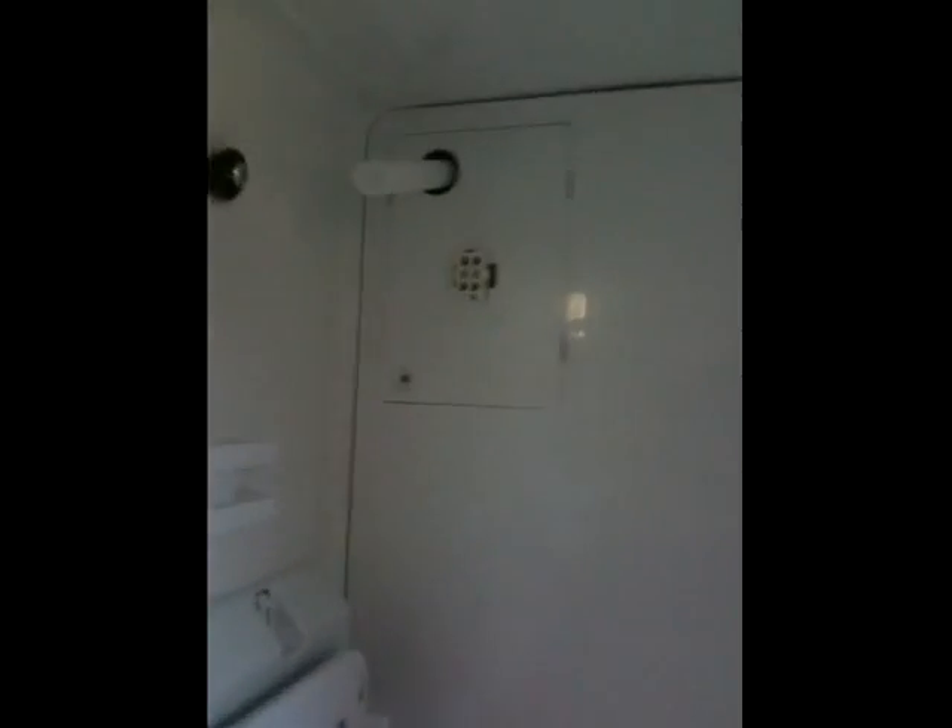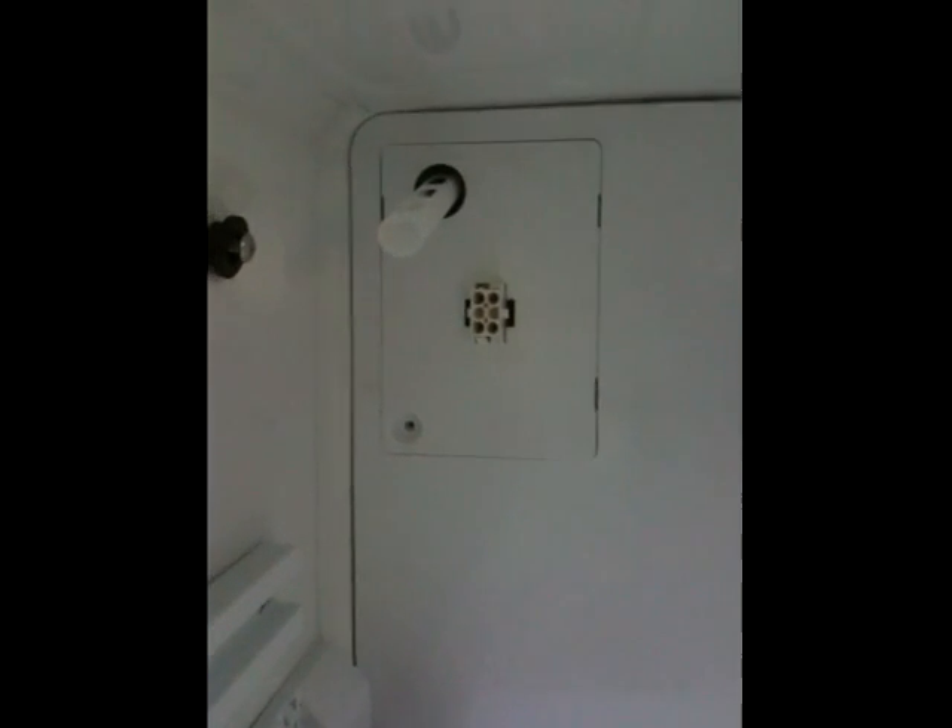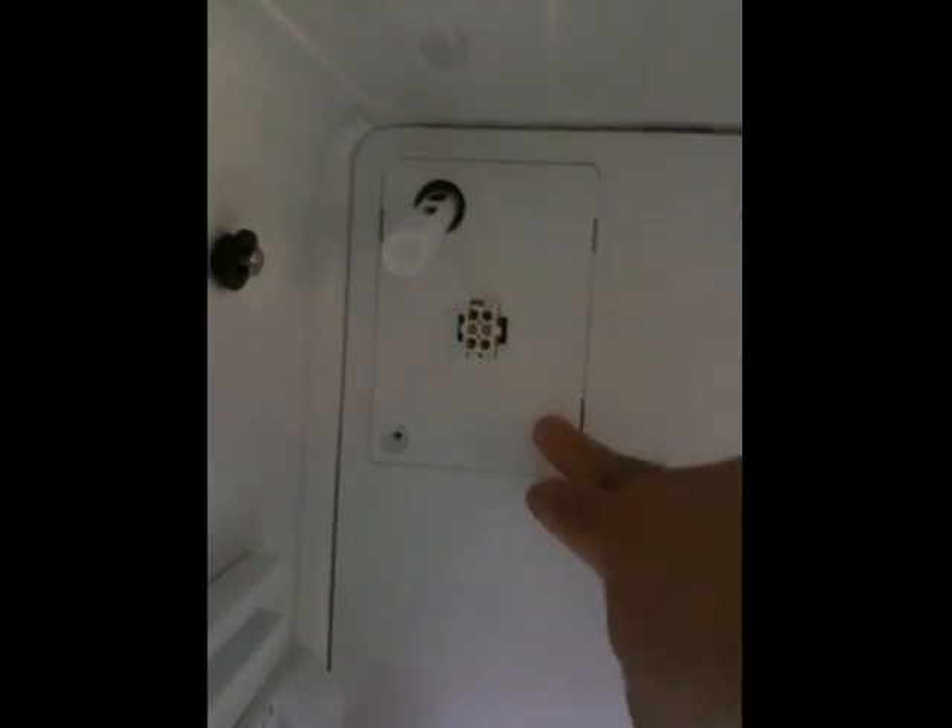Just a few little reminders when putting back the rear panel - it just pushes in, but be careful. Make sure that little piece is out through its hole before you start pushing in. You want to put this side in first, pushing that side, and pop the screw in last. When pushing this panel in, there are four clips - make sure all four push in. It'll feel really tight up against the evaporator back there, but that's the way it's supposed to be. There are also three tabs down here that have to go in.